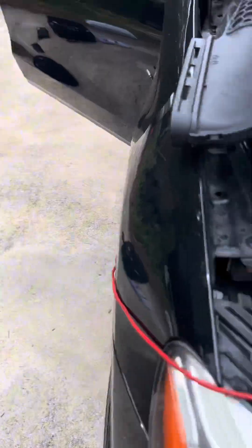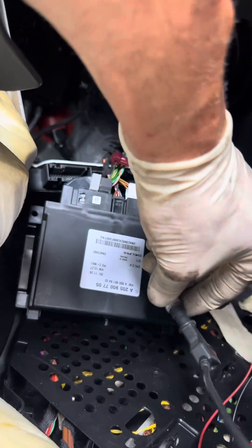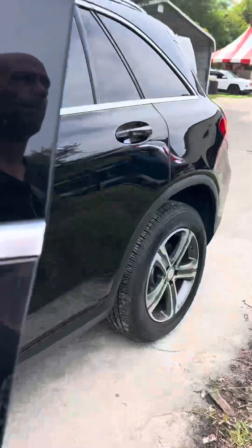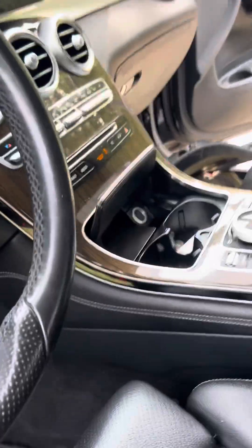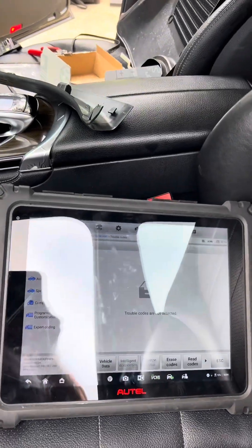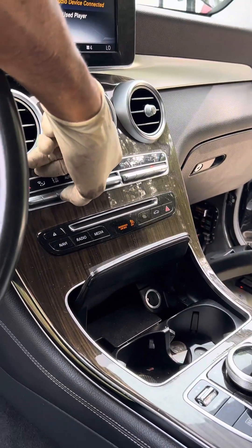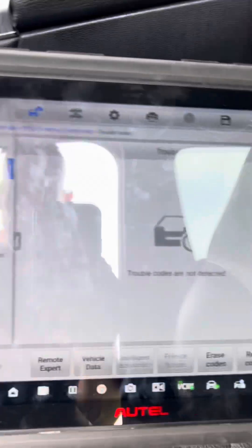What I've done is I've got a jumper wire going into the LIN bus. And look — the fan shuts off immediately. Let me put my key in. And look at that — the fault's clear. Now I know I've got a wiring issue. Where is that separation point? Am I going to find corrosion? What am I going to find? But at least I know now it's figured out — it's a wiring issue. Let the fun begin.